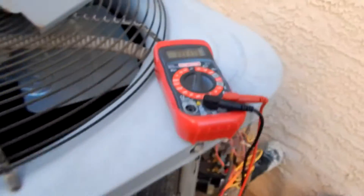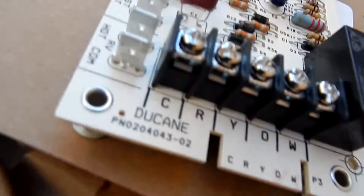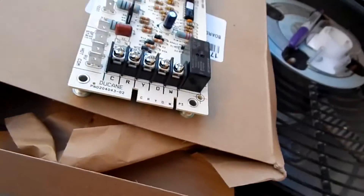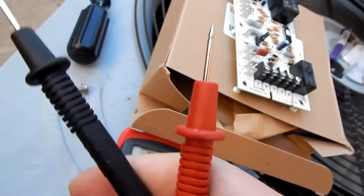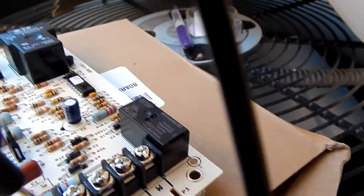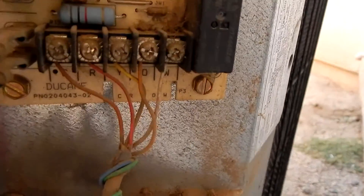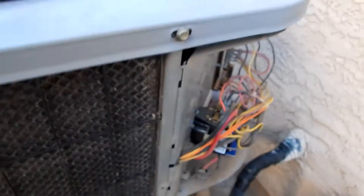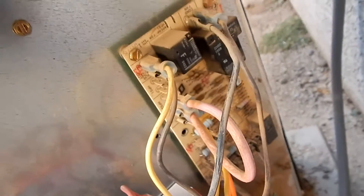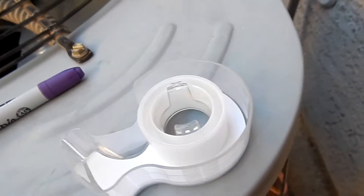Okay, I've got all the power off. Now you want to double check your power. The way to check if this board has power is there's a C screw and an R screw right there. Get your test probes — stick the black one on C, which stands for common, and R for red. We have nothing, because obviously this board is not connected. Now the next part is you've got to take pictures of this board, of how the wires are all wired up. Then get some scotch tape and a Sharpie.